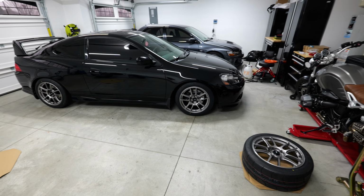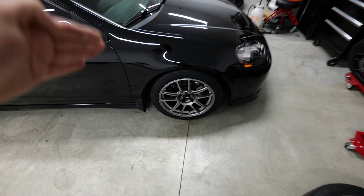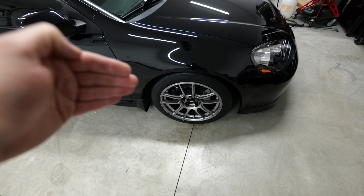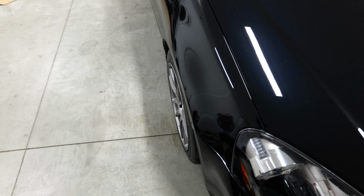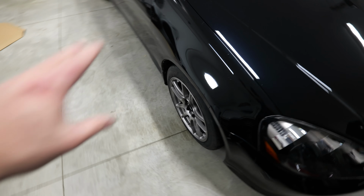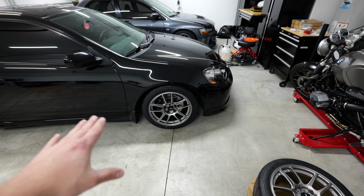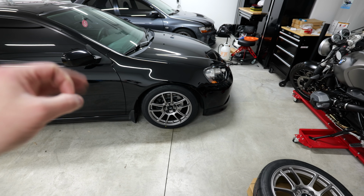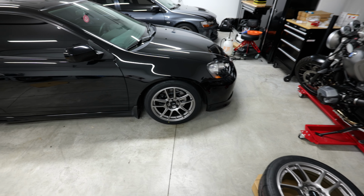Very OEM plus, and it kind of reminds me of the fitment I have with the Decagrams on the Civic. The extra half inch really gave it a lot up front here, so you can actually see I have a little bit of poke there, giving that a nice aggressive stance. This could be lower here for sure. If I were to make any adjustments to the suspension, I would drop this down maybe a quarter of an inch or so, just to get the spacing more correct.